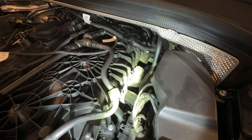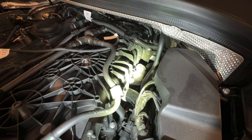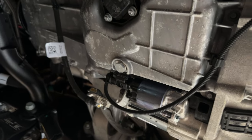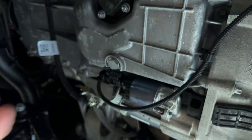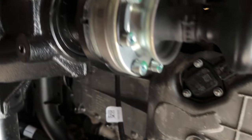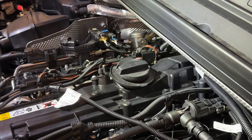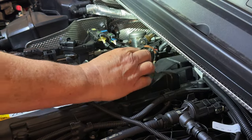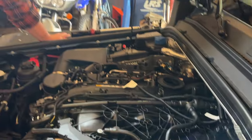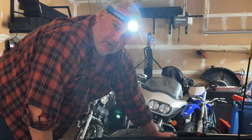This is not an easy place to get to, but hopefully it won't be too difficult. Let's take a look underneath and show you where the oil drain plug is. The oil drain plug is right here, next to the starter. Just for reference, the transmission pan is the black plastic one behind it with its own drain plug — don't pull that one. You want the engine oil drain plug, which is basically right above the drive shaft joint. The first step in our oil change is to remove the oil filler cap to let a little air into the motor and make the draining smoother.